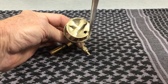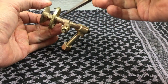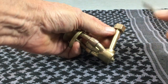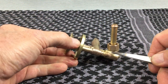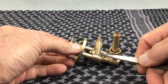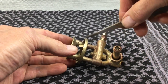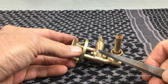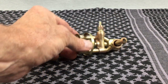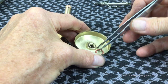The dummy tube is actually useful — you can put your denatured alcohol right in the top of the burner, have it flow down through the tube and out the bottom into the spirit pan below. Because of white gas's ability to vaporize so easily, the feed likely never actually goes into the burner head but only to the end of the spindle, where heat conducted from above causes it to vaporize. My guess is that both tubes are dummies and the head just acts as a heat sink to conduct heat to the spindle.